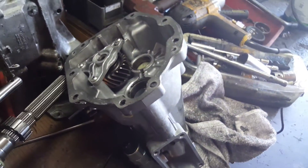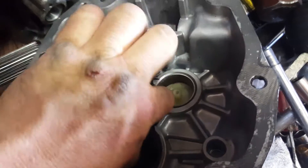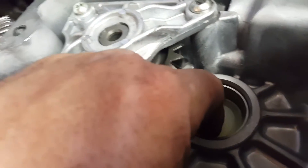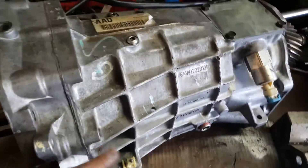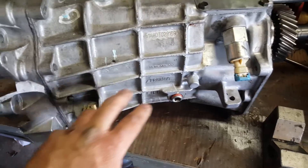Of course you're going to want to bolt the tail shaft on first, and before you do that, go ahead and remove the reverse idler — it's got a torx bit on it. As soon as you remove the reverse idler, you can pull this out, and there's a little shim right underneath it. You get the shim pack — they're all over the internet, eBay has them, the gear box, etc. So as soon as you get that reverse idler off, throw a couple bolts into your tail shaft and throw it on. First you have to do the countershaft, which I haven't done yet. Assuming you've already done the countershaft and that's all shimmed up, then you're ready to do this step last.